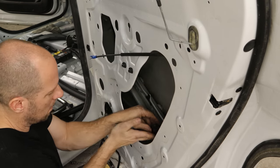Now we're going to unpack all of our seatbelts and airbags — they're all rebuilt. Before we can install them, we need to put our foam back in the bottom of this pillar that we took out. I put a little hose on the end so that I could reach down in there because the gun doesn't fit all that well. It expands pretty fast — you've got about 10 minutes until it fully cures and it starts expanding as soon as it hits the air.